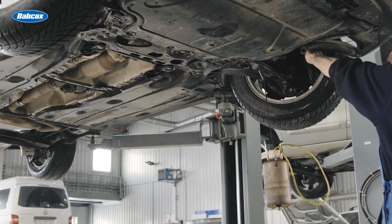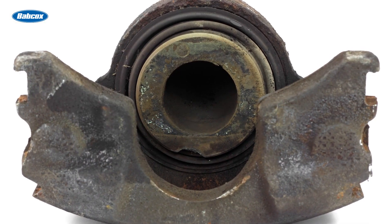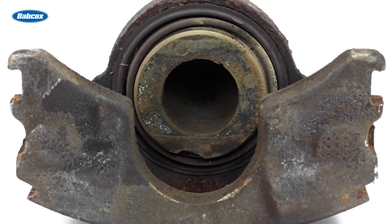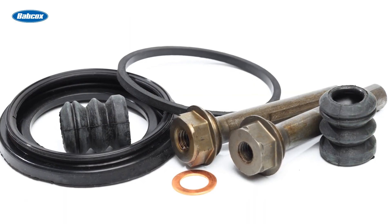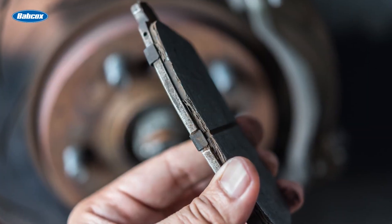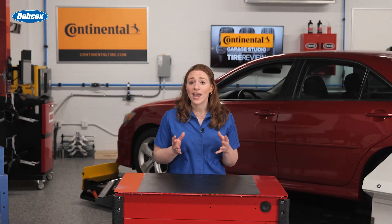To correct this type of wear, inspect the hydraulic brake system and the caliper for residual pressure and damage to the guide pinhole or piston boot. If the pinholes or piston boot are corroded or damaged, they should be replaced. Bottom line: never take rust or corrosion lightly. Corrosion on the caliper and pads is an indication the coating, plating, or paint has failed and needs to be addressed.